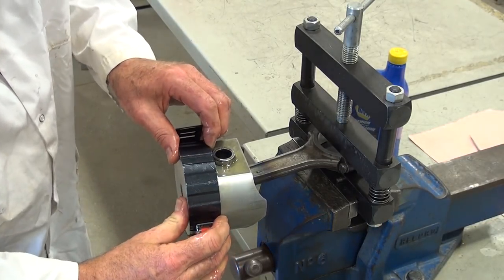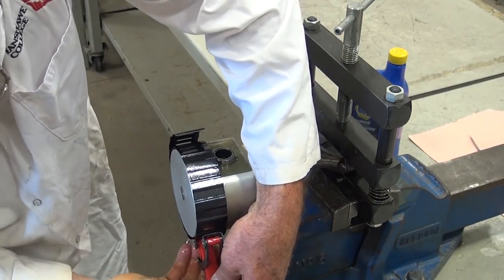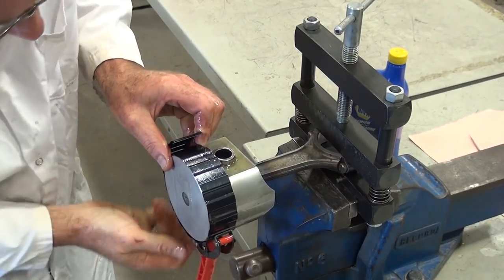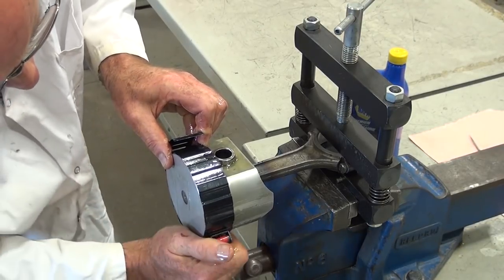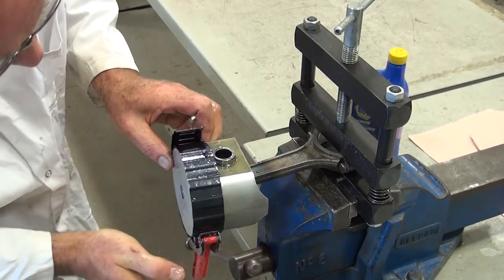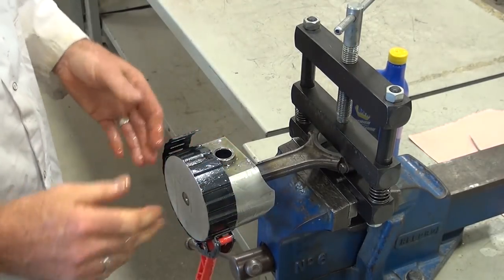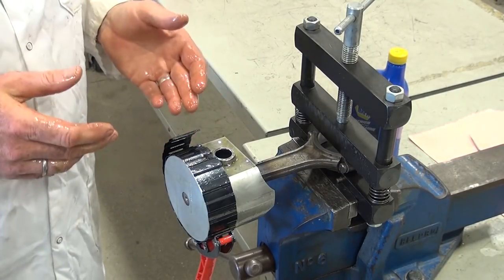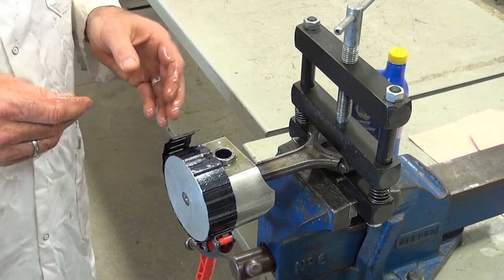I back off the compressor just a little more and tighten it up for a slightly tighter fit during installation. If you cannot move the piston ring installer while it's on the piston, you have it way too tight and will be hammering the piston too hard to install it. I've got my gap set. The next step is installing the bearing and protective covers on the hardware prior to installation in the cylinder.